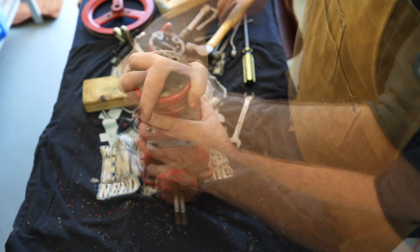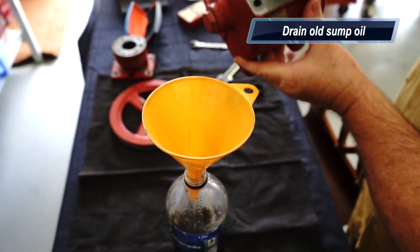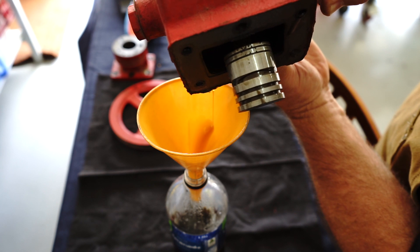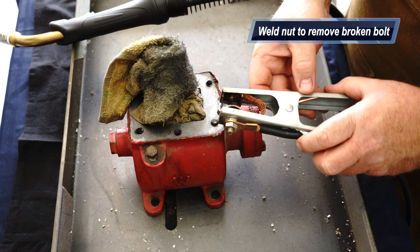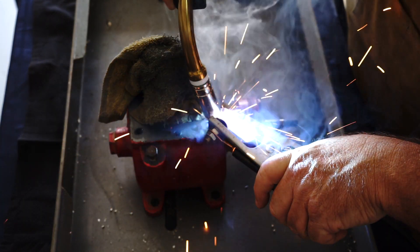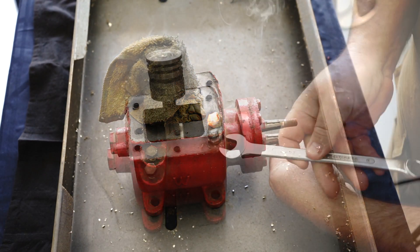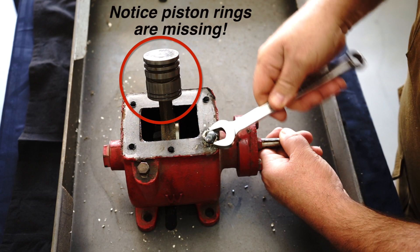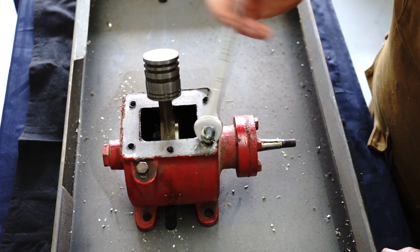As I tried to remove the barrel it bit me on the finger. You can see that broken bolt in the bottom right-hand corner — to get that out I'll have to weld a nut on it. I'll drain the crankcase of the oil and just use the MIG welder to weld that nut over the broken bolt. It does two things: it allows me to put a spinner on it, and the heat gets in there and loosens it. You'll notice there are no rings on this piston, so I'll have to make a set of rings for this motor. I've got the broken bolt out quite easily.